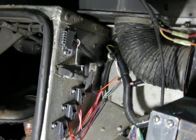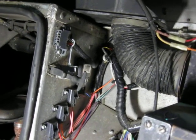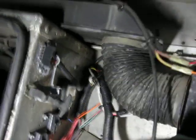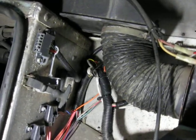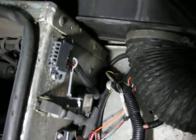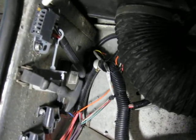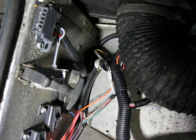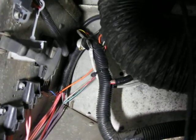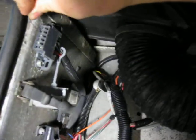There are a few different ways you can test the fuel pump, or actually hot wire it to work, in an OBD1 setup on a 1995 and older GM car and truck. This is an OBD1 connector. Here's the A and the B terminals. If you put a paper clip between these two, with the key on, you can get engine codes.